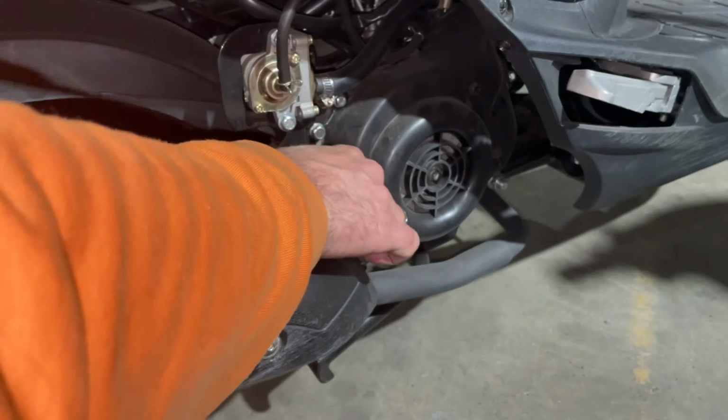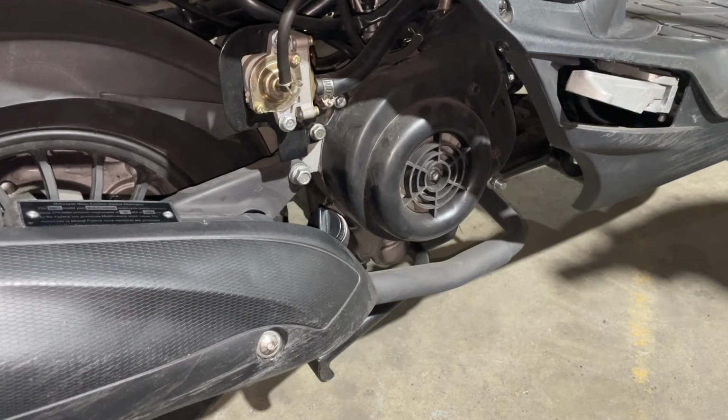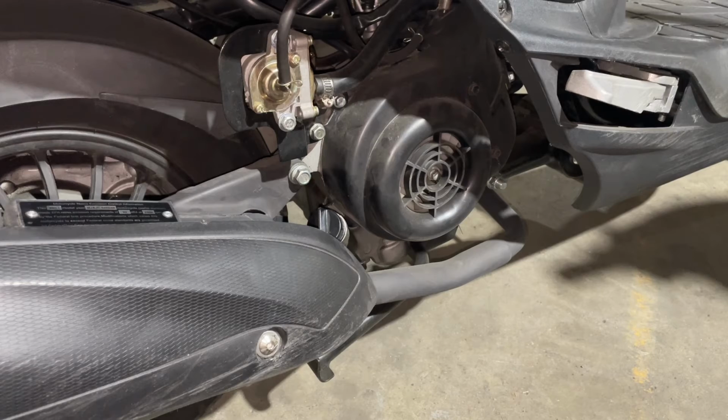And you'd want to change your oil on these scooters, I would say at least every 500 to 700 miles. And I know that's saying more times than recommended, but these are a 50cc engine, and you do want to make sure that the engine oil is still really good in it. If you put synthetic oil in it, do not do that during break-in period. Synthetic oil and break-in time just doesn't work out. So go with your regular oil for your first few oil changes, and then you can go to a synthetic. And then you could probably go to maybe 750 to 1,000 miles, but 500 to 750 is what I recommend between oil changes. And like I said, I haven't read the manual on this. I just know from experience, if I was going to be riding one of these, I would be changing it every 500 miles or so.